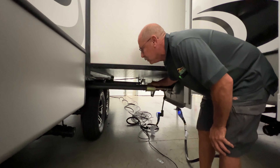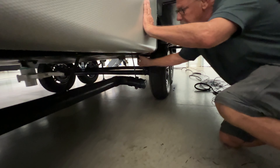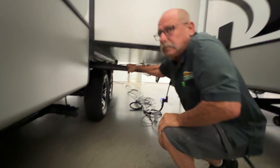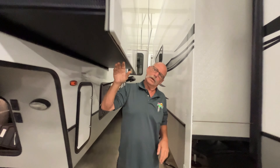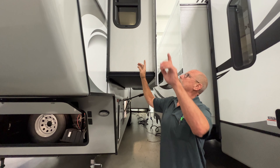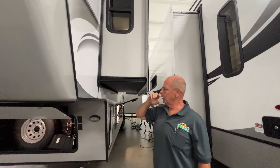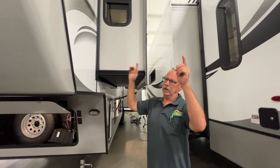This slide's a little different — this is a geared slide. This is your actuator for it right here which runs it; the motor's on the other side. If anything ever fails on these, you go to the motor on the opposite side and you can manually run these in and out so you don't get stuck out somewhere. This whole square tube, the gear underneath — all the way back in the frame — you want to keep these sprayed down with dry lube. Don't ever use lithium grease or something like that; it will collect everything and gum these up and create all kinds of problems. There's one at the other end too that you're going to have to do, so it's important to keep those done.